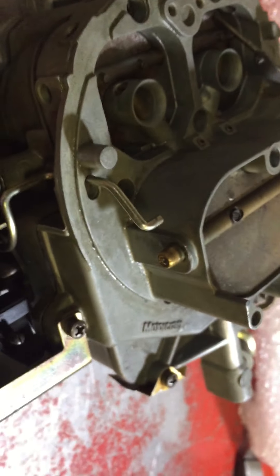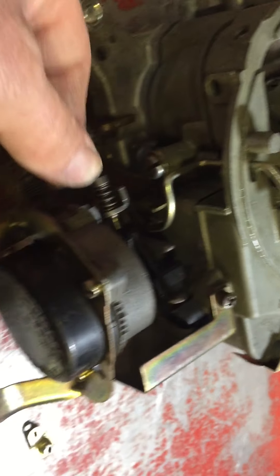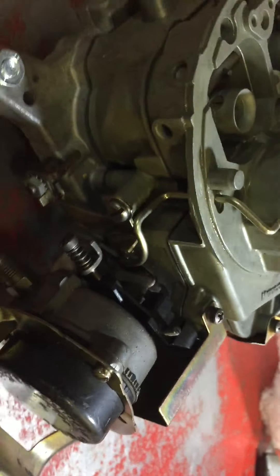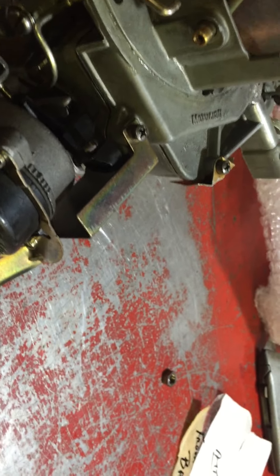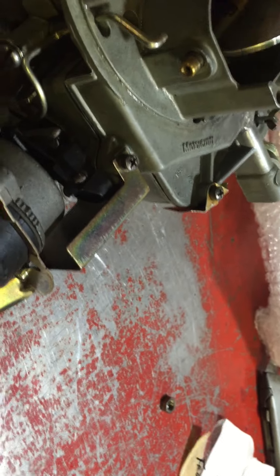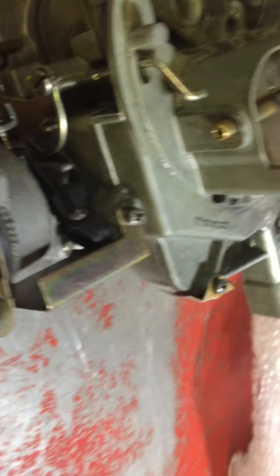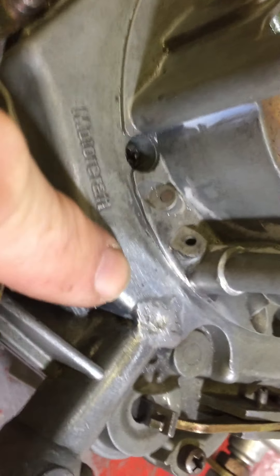Your choke was probably not operational. It's a heat choke anyway, so unless you've got heat to the intake manifold it wouldn't have worked as a choke normally would. Normally you'd just spring load it open. I can discuss that with you — whether you want a working choke or just want me to have it permanently open.